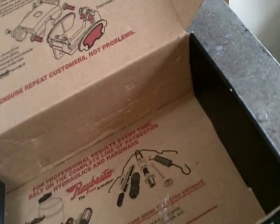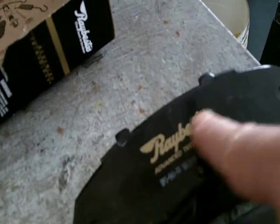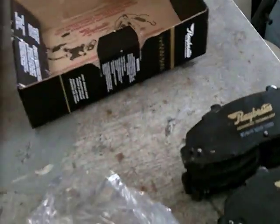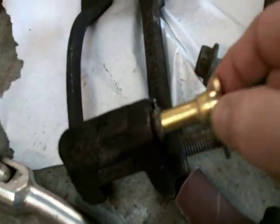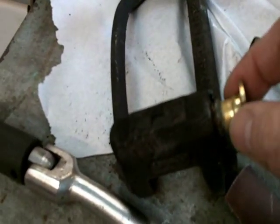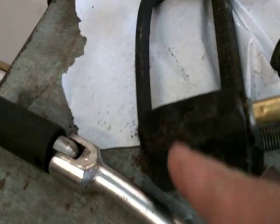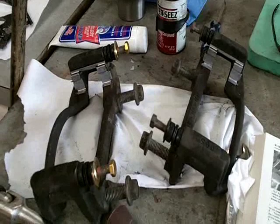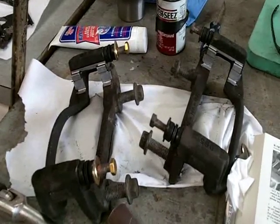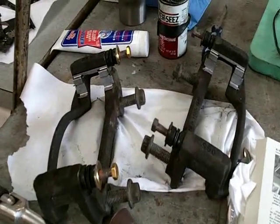There's a little bit of the special silicone grease I'll put on those shim surfaces. The instructions say to put a little lubricant along the edges where the brake pads ride. I've also greased up the caliper pins — you want to push them back and forth a little bit to make sure you haven't created a total air seal in there, otherwise you go to push it in and it'll push back out because you put too much grease in it. Caliper brackets: greased, never-seized, cleaned up, and ready to rock.